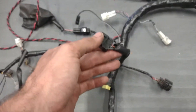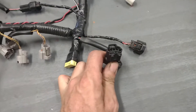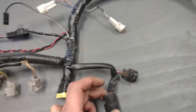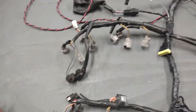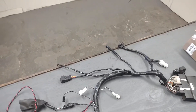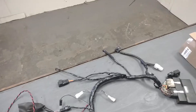Shooting on across, we're going to jump into another plug that goes to the manifold pressure sensor. It looks very similar to the atmospheric pressure sensor, but that one is connected to your throttle bodies. It should have four vacuum lines that come off of it, connecting to a T and then coming back to this manifold pressure transducer — it's got three wires in it and is shaped slightly different. If it's not plugged in, the car will not run appropriately at low end; however, it will run okay in the upper RPMs. These bikes are programmed to run off map-based tuning for lower RPM and idle, but when you're in the throttle it transitions over to looking solely at the TPS signal — throttle position — and controlling the fuel based on throttle position.